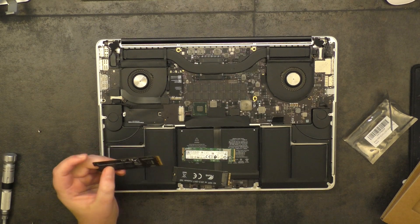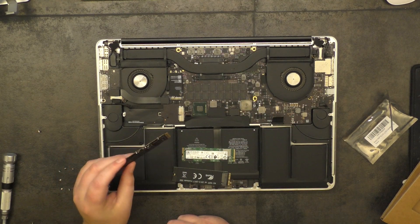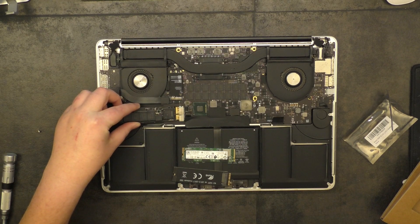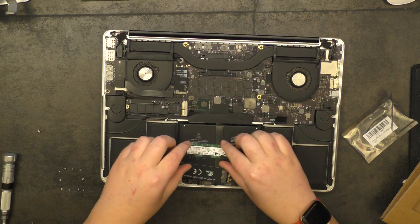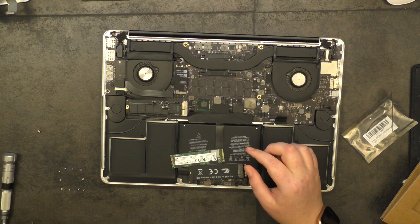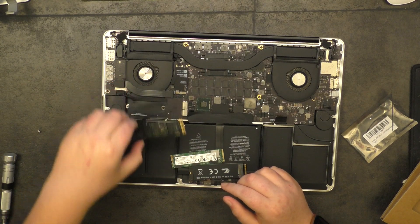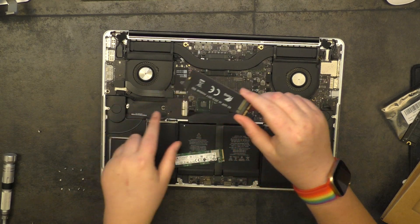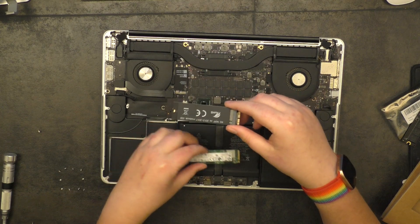You may want to pull the battery when you do this. I personally don't — it's not going to matter to me, but if you want to be careful you can. The Apple SSD just goes in like this — rock it back and forth. You just unscrew it; I believe it's a Torx T4. Rock it gently out of place and out it comes. The adapter has a backboard that runs the length, because the logic board ends right here and there's a pit, so this gives the NVMe SSD more support.